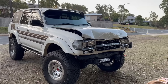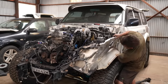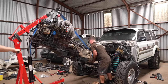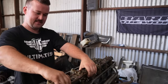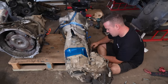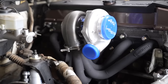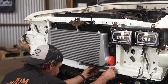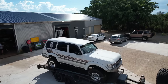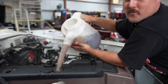Welcome back to another episode of our Toyota Land Cruiser 80 series build. Previously the 80 was unfortunately involved in an accident and needed a front end rebuild, which snowballed into us deciding to do a turbo Barra conversion while we had the whole thing apart. So far we've stripped down the 80, removed everything from the Ford Territory we're using, installed billet oil pump gears and heavy duty valve springs into the engine. We've got the ZF auto adapted to the cruiser transfer mounted to the four litre Barra block and into the 80 series. We've got a big turbo mounted with exhaust manifold, intake and injectors, all the new panels, radiator, intercooler, and fabbed up the bar work. Today's episode is a huge one because it's time to get the 80 all wired up, turn the key, and see if this engine will run after months of work.